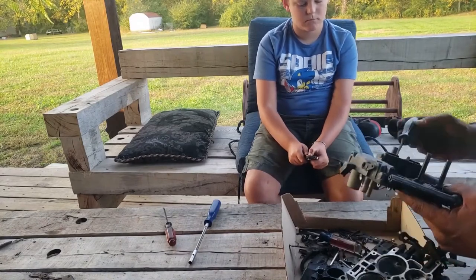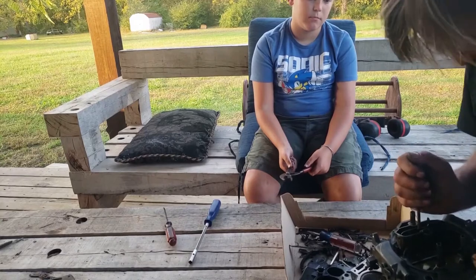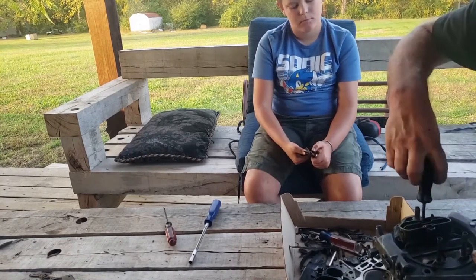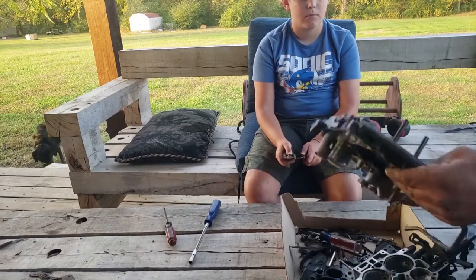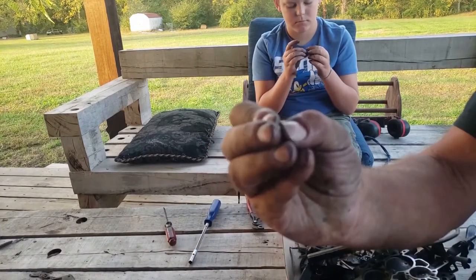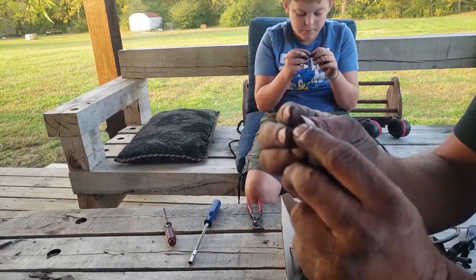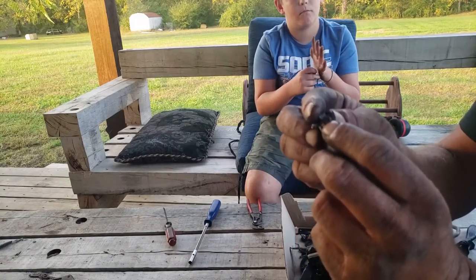We have one other thing that needs to come out, Jacob. Right here is your accelerator pump nozzles. And it is really not wanting to come out. So I'll go ahead and pull this out and I'll show it to you. Come on. Okay. So this nozzle has a little weight with the needle. That little weight in the needle is a check valve. And this is an important piece when we go to put this back. Now this is similar to the Holley in the sense that these little nozzles are sized. And that size can adjust out a bog or a hesitation under a quick acceleration especially.